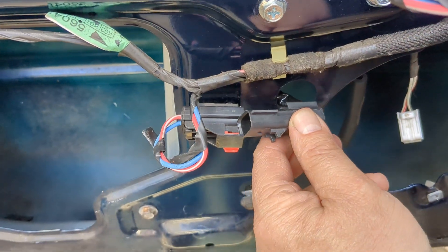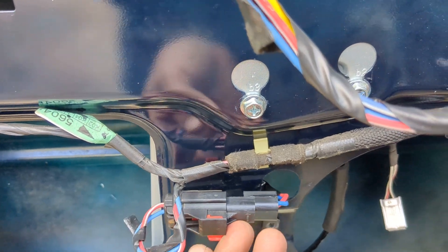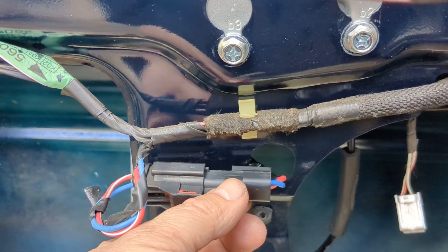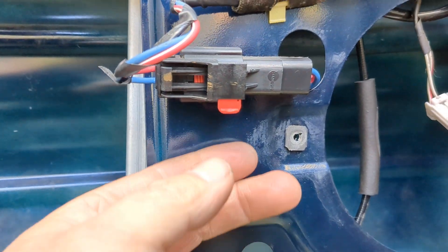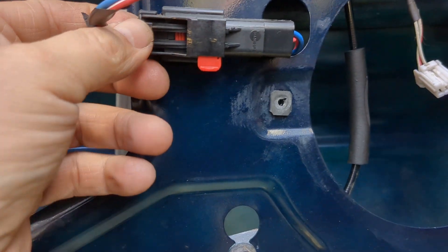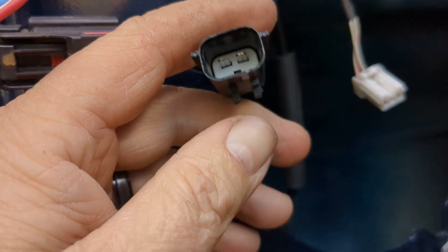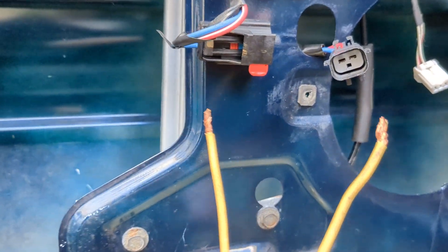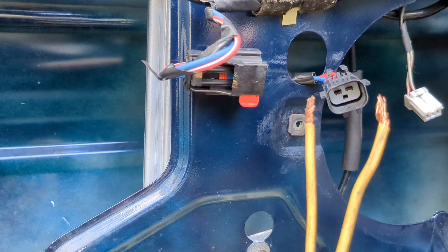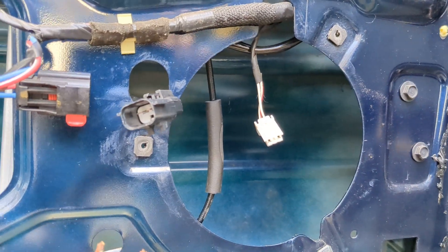Access the wire. In this case, this was the plug to get to the window — here's the harness, wires going in, and this plug goes to the window motor mounted on the inside. This one is a simple pull tab. Keep in mind, this is for any vehicle, not just a 2001 Dodge Dakota. So we pop this here, then push down this handle, and the plug comes out — boom. Inside that plug you'll see two contact points. You don't know right out of the gate which one will make the window go up or down. You're going to use your battery — it's kind of a two-handed thing. Take one wire on one side and one on the other, touch those, and that creates the power to run the window down. You don't even need the switch. I'll try my best to set up my phone and do it.